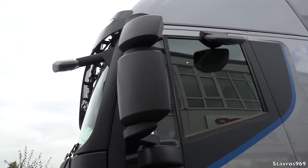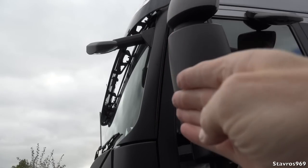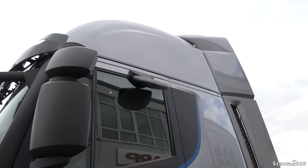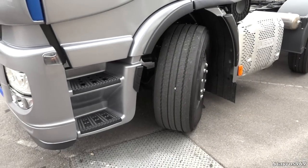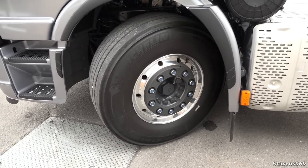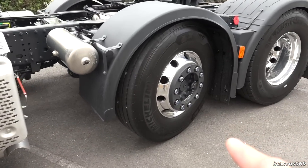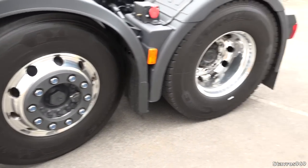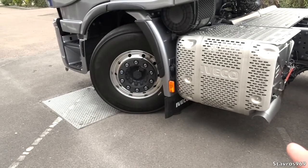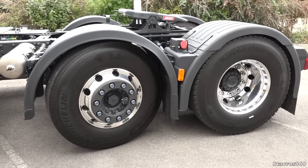The mirror design is actually quite good, but they are housed a bit too close to that pillar, so there is a bit of a blind spot on the interior. Hopefully it's something they have improved on the new S-Way coming next year. What's quite unusual is that we have a 65-profile super single tyre on the front axle, then a 315/80 profile on the midlift and a 315/80 profile on the rear axle.